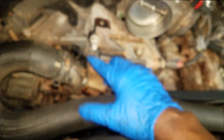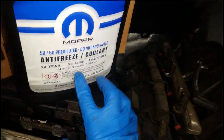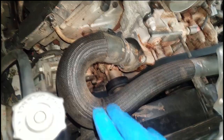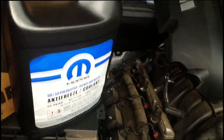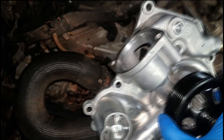When I wrote up the estimate, I'm going to replace the water pump. I highly suggest you get a brand new thermostat with it, and I also highly suggest using Mopar parts - this is a brand new Mopar water pump, high quality. Make sure you get the correct coolant. Most of what you can see is orange-looking, so they had the five-year orange coolant. The 10-year coolant was used in 2014 and higher model Chrysler/Dodge products.